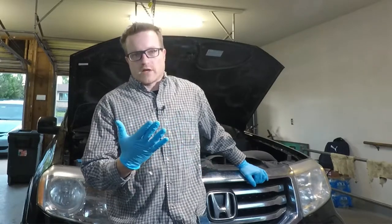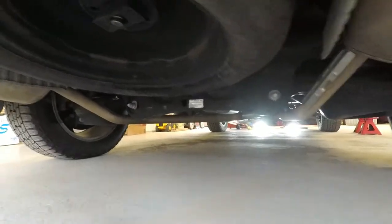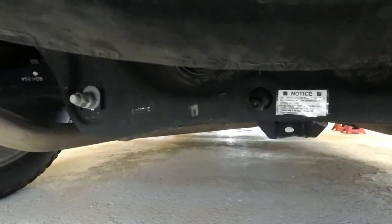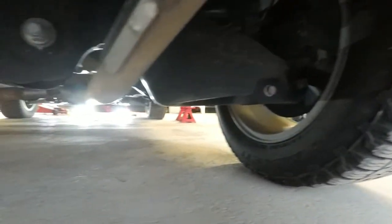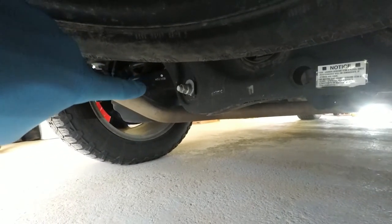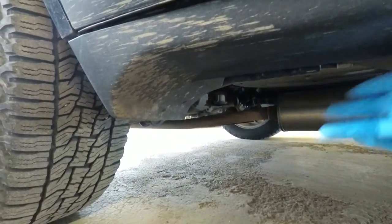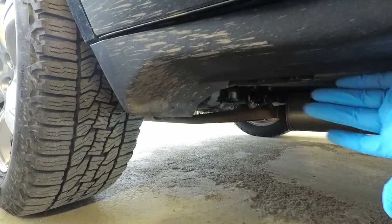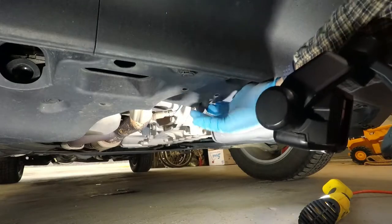Let's take a look at what I would normally do to lift the front of the vehicle for an oil and filter change. This vehicle has four wheels and a couple of rated jacking points. Under the backside, there's a spot under the rear bracket that's a good lifting point for a jack. The rear independent suspension doesn't offer many other good options. You can also use the pinch weld points — those are designed for the regular jack that comes with the vehicle, just for changing a tire, or as a four-point lift on the front.